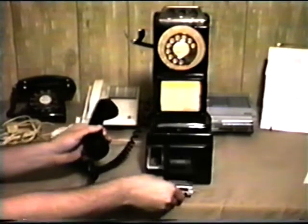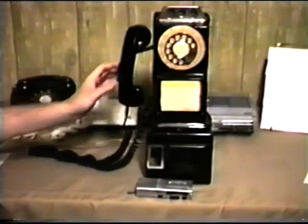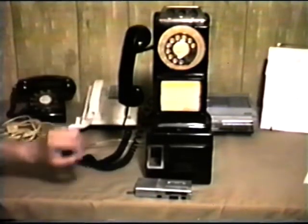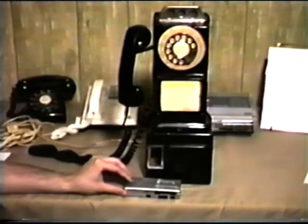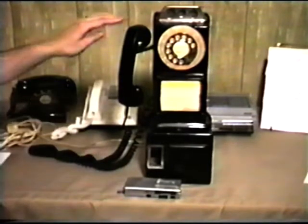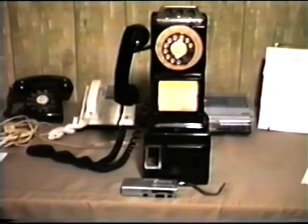If the AX computer said insert $1.25, we would beep in 5 quarter tones on the cassette player, plus the original nickel that we put in. After the proper amount of money has been inserted into the pay telephone, the AX computer will say thank you and tell you how much overtime towards credit you have. The call will then be placed, and actually all we really inserted was a nickel and beeped in the rest of the money using the red box.